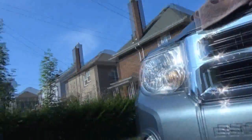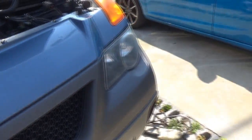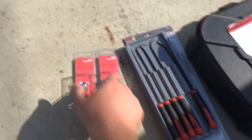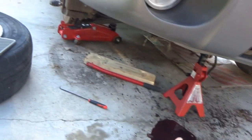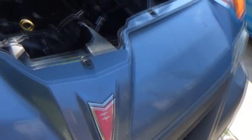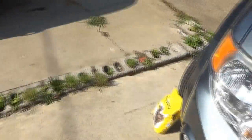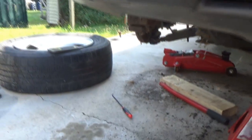I may still have to cut off the ones on the transmission side. I ended up going to get new fittings — these are what they gave me — we're going to replace both of them on the transmission. The ones on the radiator still look fine, but the ones on the transmission are awful. I'm going to get some kitty litter to put down — there's actually a lot more fluid in that radiator than I thought. Why spend money on expensive absorbent when kitty litter is like a dollar and works just as good? That line is free — I have no idea if that's our sender or our return.